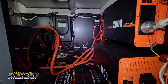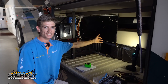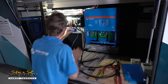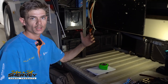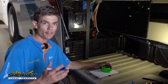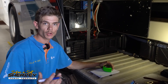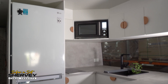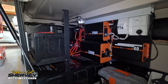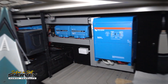So what we've done is we've removed all of the unreliable gear that was already mounted in there. This board here, we'll be taking that out, fitting a whole new board to the back area to mount all of our new Victron components. We'll be putting new Victron solar regulators in, also a Victron smart shunt monitor, and also a massive Victron 5 KVA inverter charger — because he's got so many 240 appliances inside the van like a big fridge and a massive aircon. He had a 2000 watt inverter and a 3000 watt inverter — it was all over the shop — and that's why we've gone with these quality components.